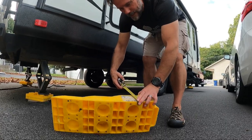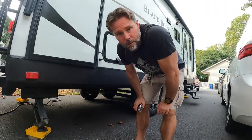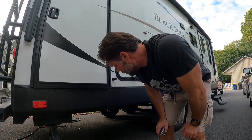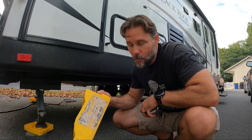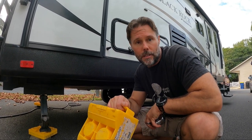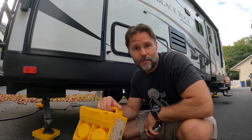Before I do, I want to give an indication. The top platform is four inches high and then it's got the lip on top to stop things — it goes all the way up to five inches. We'll pull the trailer up on this. We're going to get some of the wheels off because I'm also going to inject the Dexter axles with new grease in the bearings. I want to test to see how this ramp works since we don't have a bottle jack. If I can get at least one wheel off the ground and rotate it, I know I can take that wheel off and change it in an emergency — and I don't have to spend money on a bottle jack. It's easy, it's safe. Let's see how this goes.